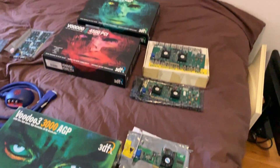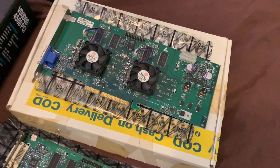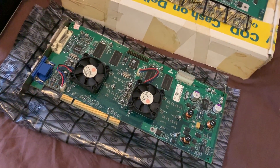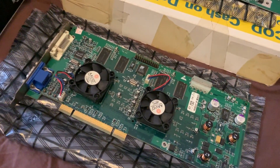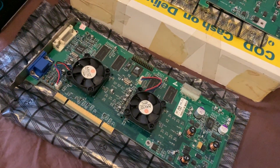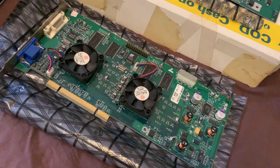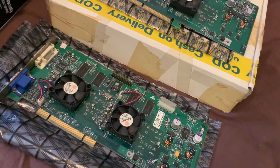The Voodoo 4 came out around October 2000. The final card from 3dfx is the Voodoo 5. There were three main models: the AGP version, the same in PCI, and a PCI with DVI for Mac computers — which can be flashed to work on a PC. The Voodoo 5 is essentially a Voodoo 4 with two VSA-100 chips, giving it 64 megabytes of RAM. However, like SLI, textures are copied between the two chips, making it effectively more like a 32 megabyte card but with nearly doubled memory bandwidth — almost like a 32 megabyte DDR setup. It runs at 166 megahertz.